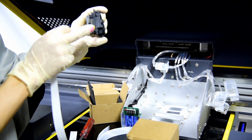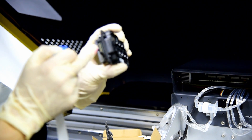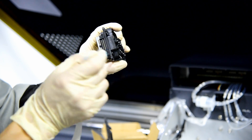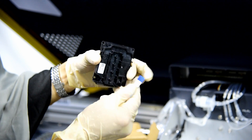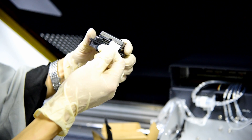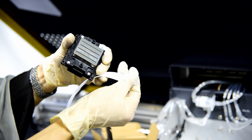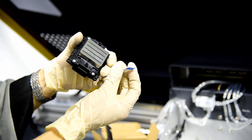When we look at the port, we can see they have pins. The down port has the pin at the down position, and the up port has the pin at the up position. On the cable, we can also see one side has a pin and one side without. We connect pin-to-pin first. Before you install the print head cable, you must be sure that the pin is flat.